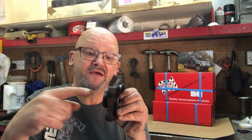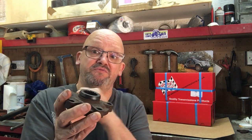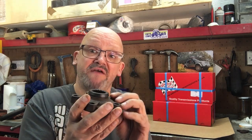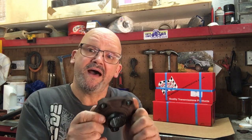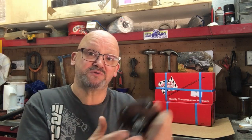It's just all grinding together and because the shafts can float in and out, they will actually just rub themselves away. The thing to do is catch it quickly when you've got some play, and hopefully because these are monkey metal and the shafts are pretty strong and hard, you'll probably just have the wear in these and your shafts will be okay. So let's get to the bench - I'll show you the wear I've got on these and then we'll get these unboxed. These are the Ashcroft ones and we'll see what they look like on the same shaft.